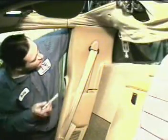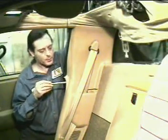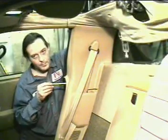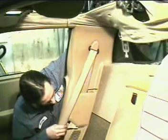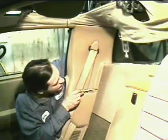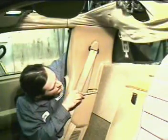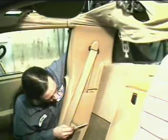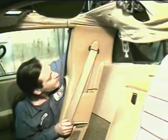Before we get started, I want to point out a few things with the B-pillar. Right here there's a really long screw — take that out before you forget about it. Along here there is a slit that allows the seat belt to slide through, and there's another slit the seat belt slides through. Along the back edge are two metal clips, about an inch and a half long each, that hold the split part of the trim piece in place.